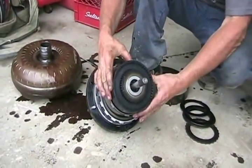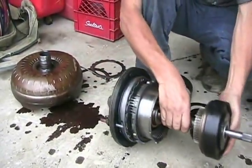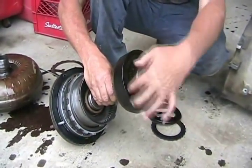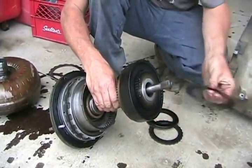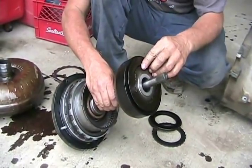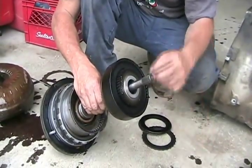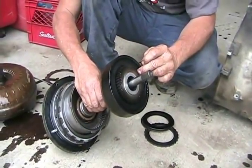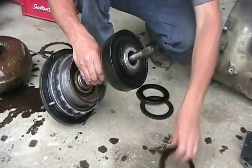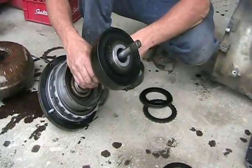On this particular transmission, there's another clutch in here, and you can notice the metal's all black and burnt looking. This is a bad transmission — even though the rest of it is good — because the clutch pack in here is burned out. The friction material got burned off because it had low oil in the transmission, and the person was revving it because there was a transmission leak. That caused not enough pressure to engage the clutch, causing it to slip when revved hard, which burnt out all the plates. Just like I said before, when automatic transmissions go bad, it's these clutch plates, O-rings, or bushings that wear out.